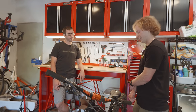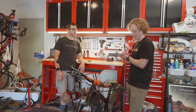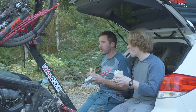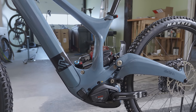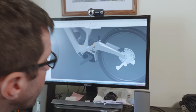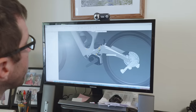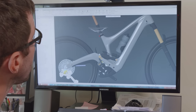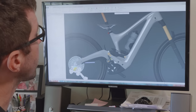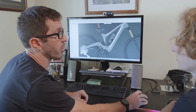This will actually be my first time on an e-mountain bike later today. I've often wondered whether it just feels like some weird middling thing with a motor strapped to it, so I'm looking forward to that. You can see the minimal space going on here — that's because the stays are so short. Because of that short chainstay, there's no way to make the rear triangle fit through here to make a chainstay, and so that's why we did the elevated stays — we decided to go over the chain instead. Overall, this bike is a whole new design in the rear suspension where the shock is driven by the upper link, which was a radical departure for us — a whole new layout from DW.